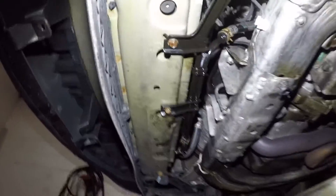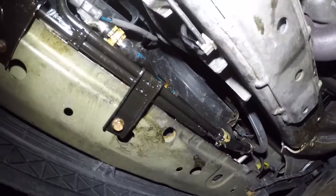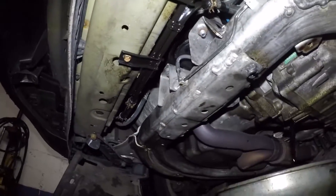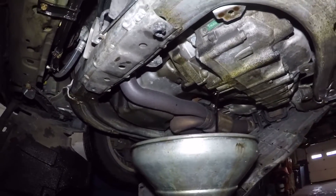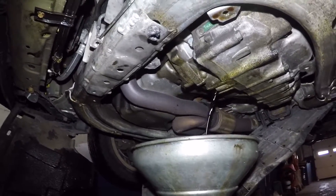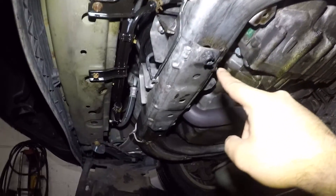I'm complete with the job here. Got the new pipe right there. Make sure you put the two number 10s in, make sure all of your clamps are secure and the pipes are routed correctly. Do top off the fluid if you're not doing a flush. In my case, I'm flushing the transmission as well — the customer brought me a fluid. The clips usually break like this one, but this was not me.